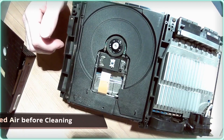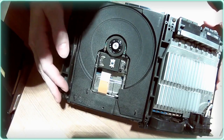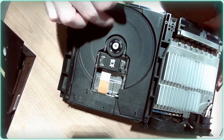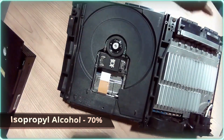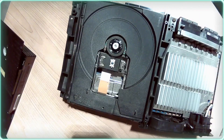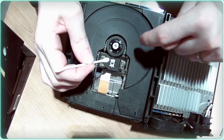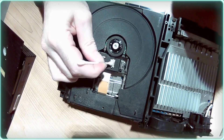I may need to grab a can of air when we're complete. Most of where the debris is looks like it is okay — it's not actually in the laser aperture area. What we're going to do is very, very gently clean this laser off. What we have here is some regular 70% isopropyl rubbing alcohol. I would suggest you do not use the 90% stuff — that is too powerful and it can sometimes cause rust and corrosion pretty well instantaneously on other micro circuits in here.